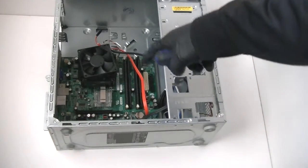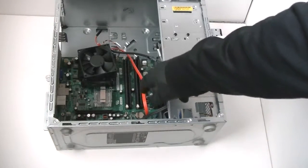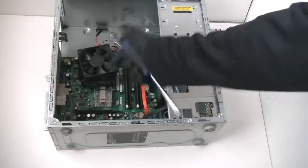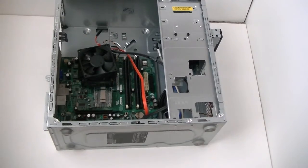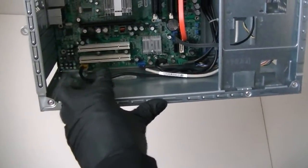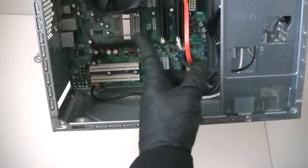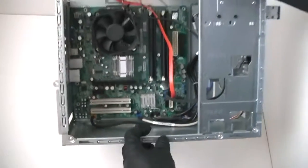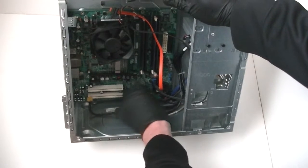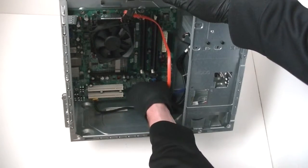Now you're going to remove and disconnect the cables going to it. This is the cooler — the heatsink fan cooler right here — the 4-pin, get that disconnected. And the audio port connected to the motherboard. The USB right here — get that disconnected. The audio connector and the USB connection go to the motherboard headers — get those disconnected. And the front panel connector right here, get that disconnected. Also the SATA cables.